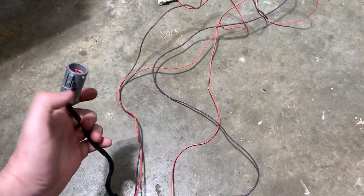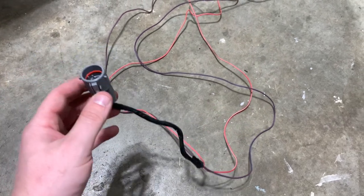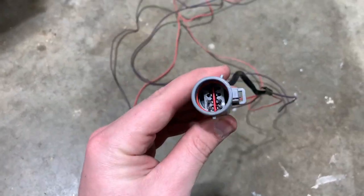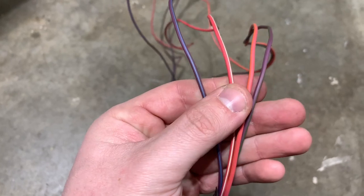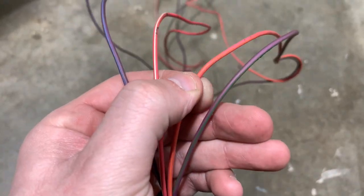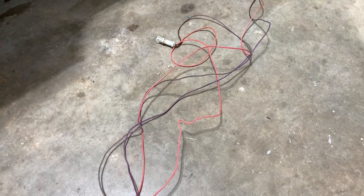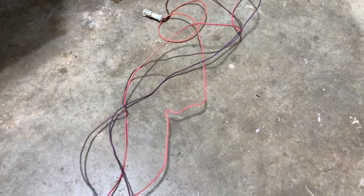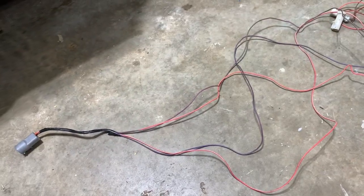The last thing I'll show you is the airbag harness. If you want to retain airbag functionality and get rid of the warning light, you've got to cut this out of your harness. I haven't seen a video where anyone gives you a close-up of the wire colors, so here they are: the four wire colors through this connector are red/white stripe, purple/blue stripe, pink with orange stripe, and purple with green stripe. This is a 93 car — this is probably only the same for 90 to 93 cars. Your other two connectors run into the engine compartment right here.